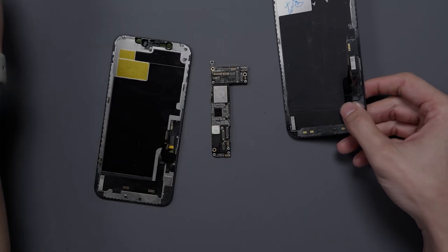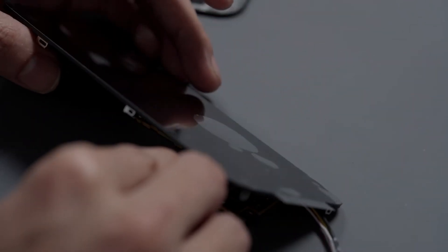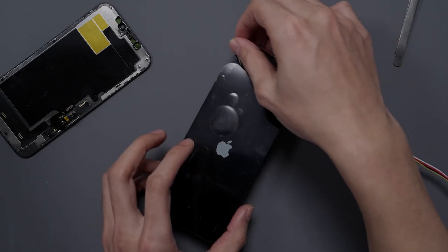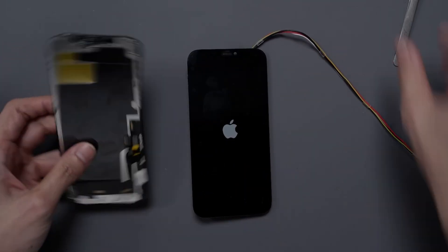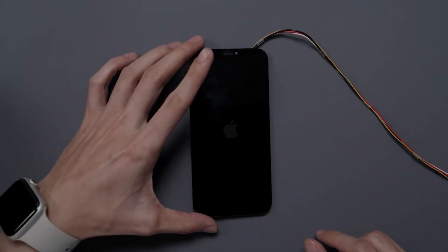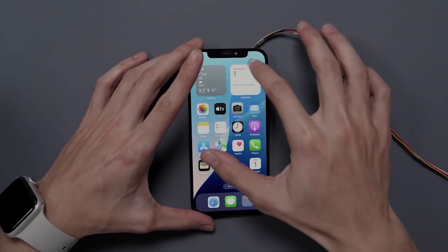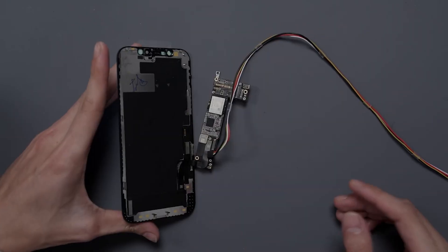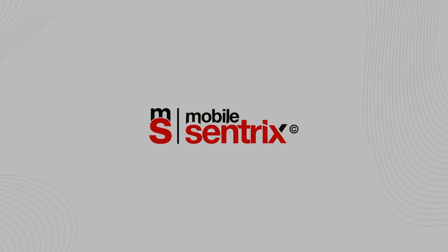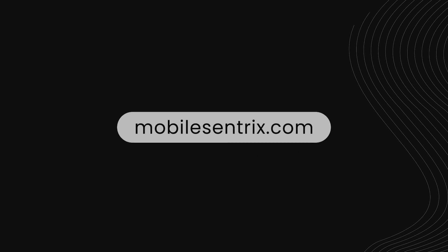Let's install the original screen to the motherboard and test it again. We'll connect up our power supply and prompt it to boot with the tweezers so that we can test and see if we have touch restored. There you can see the Apple logo, and if the touch works, that will have proven our theory that the aftermarket screen had actually damaged the connector itself, preventing the pins from making contact — and only when the aftermarket screen was used would it be forced into the position where the pin would make contact and restore touch. This repair is basically complete. We'd still have to put it back together, but hopefully that helps you guys in the future. We'll see you next time.